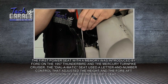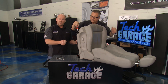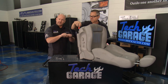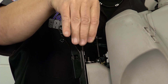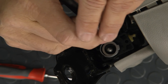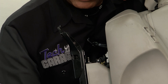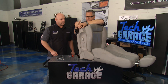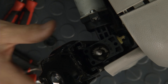This is really important: if you're doing this, the tracks have to be phased. You don't want to have one track way further forward or backward than the other. Because if this is a gear issue and we replace it, you're out of phase and you won't get the travel you want — and you could damage that new gear. Let's do a little exploratory surgery in there and see what's going on. I see some splines but I don't see anything going on in there so far. Let me pull the plate off.